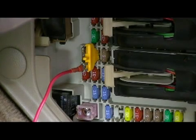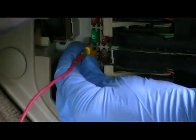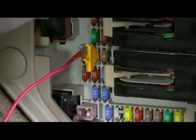You can hear from the door chime that I am obviously on the wrong side of the fuse block adapter. I am going to remove power and reverse the fuse block adapter so that I am supplying power to the top portion instead of to the bottom. If I had not gotten any type of indication on the vehicle, I would have attempted to collect data and gotten a communication error message. I would have then switched the fuse block adapter and attempted to collect data again.